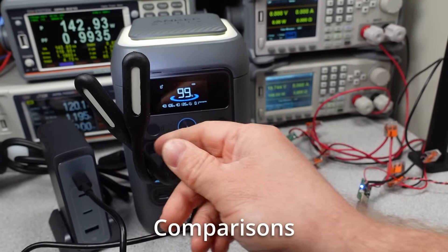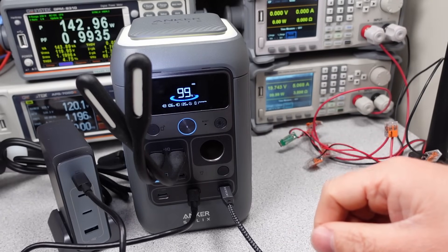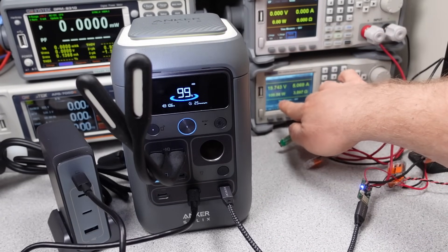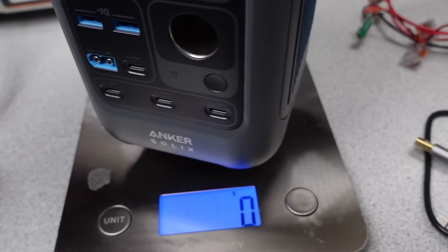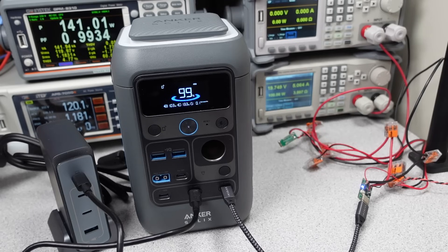Comparing this with a few other power bank options, it has some wins for sure. Compared with the only other device with the same battery style I've tested, it has a clear win. It is a little less efficient than the Anker 250 watt power bank, but this is a pretty small margin. Overall performance means it basically kept up with the smaller power bank. But in reality, I think it wins because it can do higher power levels that it claims all the time, not just for 15 minutes. The battery technology used is lithium iron phosphate — known for being more stable over the long term and safer versus regular lithium ion cells, though the main disadvantage is that they are less energy dense. It does beat the pants off the EcoFlow, but that did have an AC inverter and a built-in AC charger. Do you need to take those parts with you? Probably not — so save a little weight with this one.